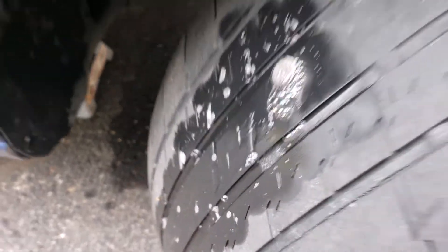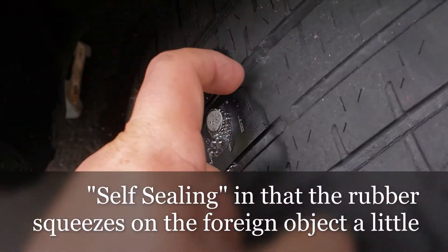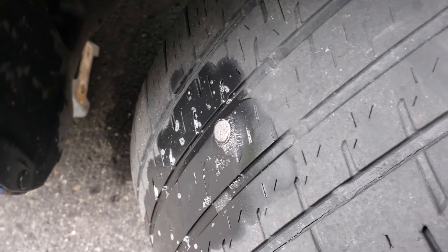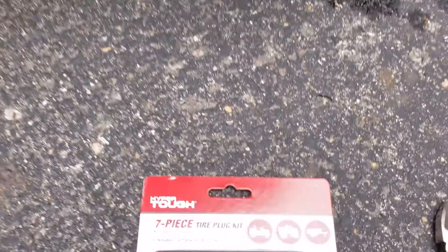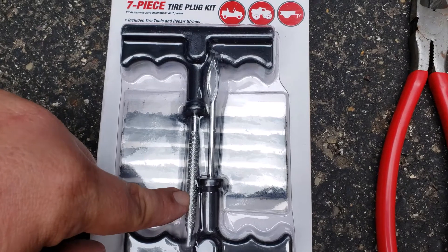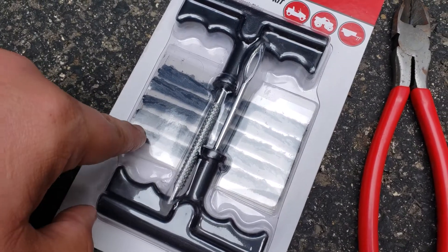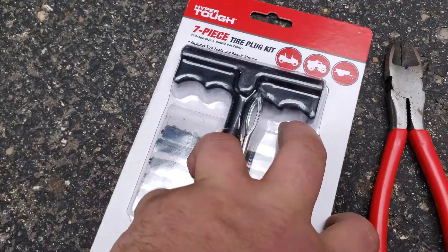You've got an option here of either trying to give that a good smack or rotate it in and hope that the self-sealing aspects of the tire are still there so you can go to your closest tire shop, or you can try to fix it yourself in an emergency. The easiest thing is basically to hit it with a plug. This is a seven-piece plug tire kit. There's a rasp tool — you pull the object out, jam this sucker in there, then take one of those plugs, put it on the tool, thread it through, jam it into the hole you widened out with the rasp, and then pray it seals.